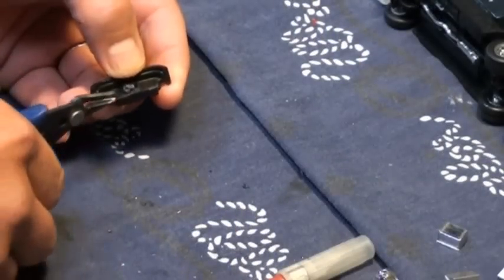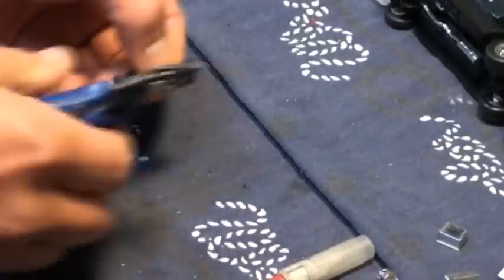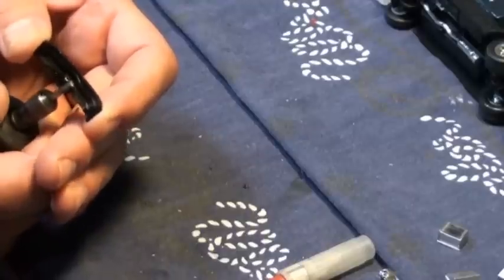The front bumper will also need shaping to fit the frame correctly. Cut excess plastic away. Use a rotary tool or file to remove additional plastic. This will take dry fitting in order to determine how much plastic needs to be removed.